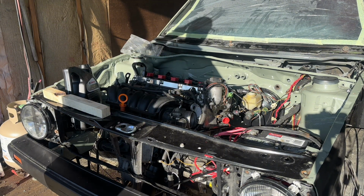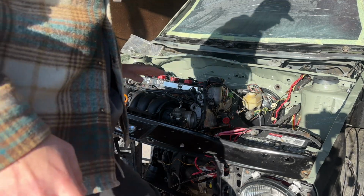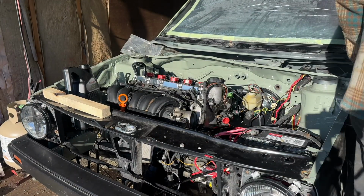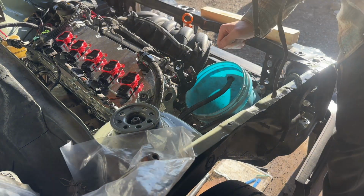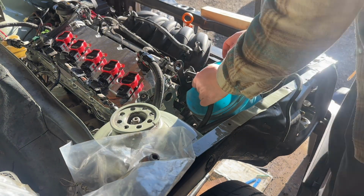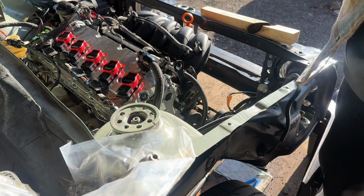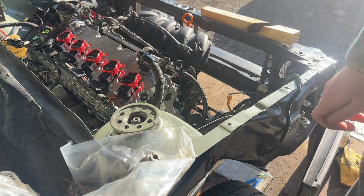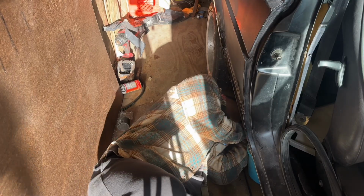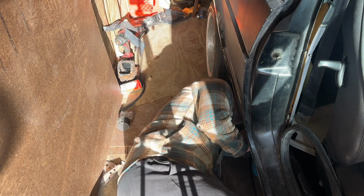Holy shit though. It blipped. Like it wanted to start. Holy cow. Oh my gosh. No, we're not even getting a lick of fuel. All right. So that would be our issue. But the pump is priming. So something's wrong with our lines. We could have our lines flip-flopped. That would be my guess.